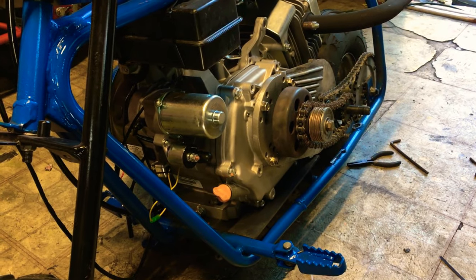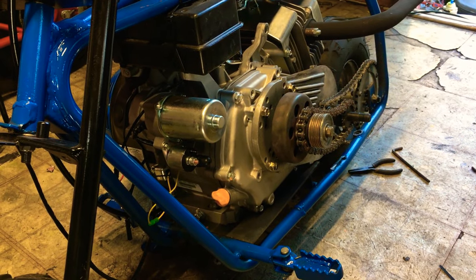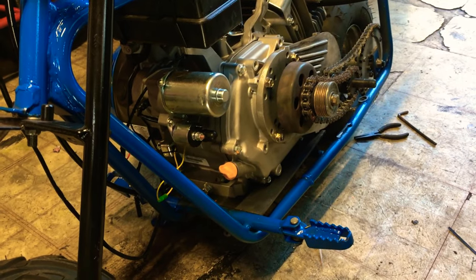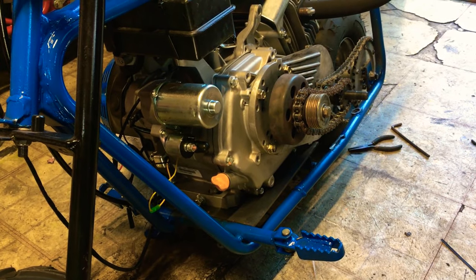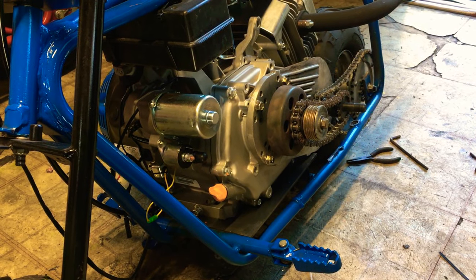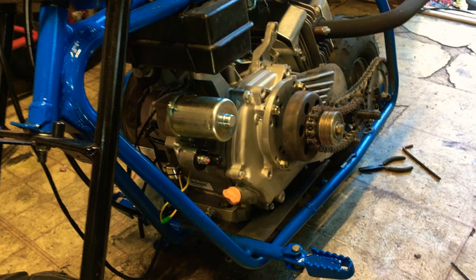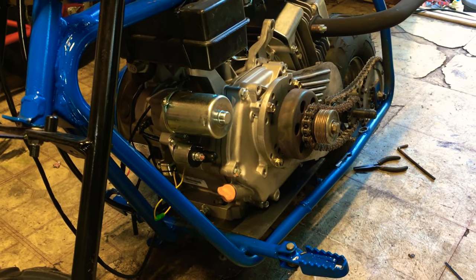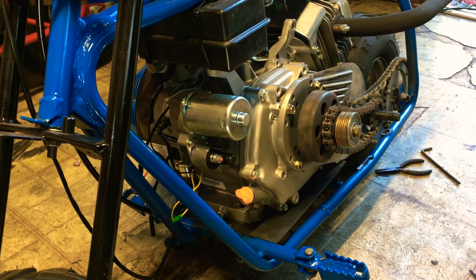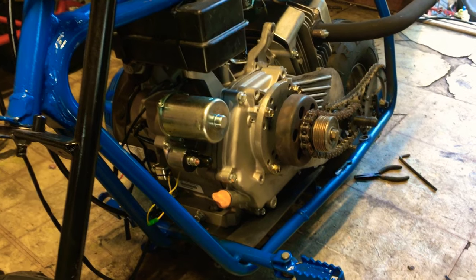Which is kind of annoying, but for what we do — we like to ride in the street, we like to do 60 plus — and this was not doing it. So we geared the bikes for top end; we sacrificed a little bit of low end to make up for it at top end, because most of the guys in the crew are still Stage 1 stock internals. You can still have plenty of torque to get off the line if you're Stage 2, because Stage 2 would rev more, but if you're not revving as much you have to gear it for top end and sacrifice a little bit so the RPMs would help you up top.